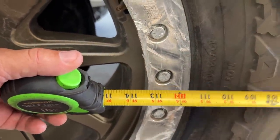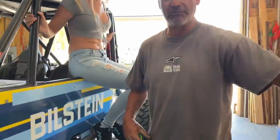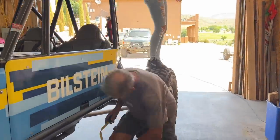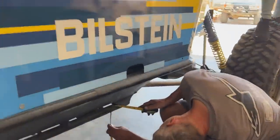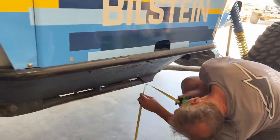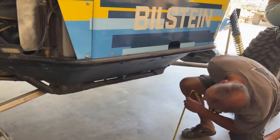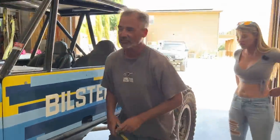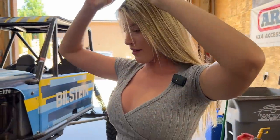That's a really good wheelbase. Oh — belly. Well, that we can't do anything about because I can't go any lower. We've meant to go lower. So belly-wise you want to be around 20 inches. I can go lower in the back but I can't in the front. Skid rail is 21 and a half inches. That's not too bad. I think it's higher in the front than in the rear — 21 and three-quarter-ish. Okay, so we're close enough. Yeah, we've actually never measured any of that before.